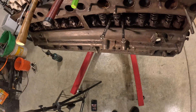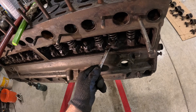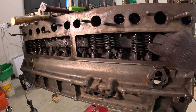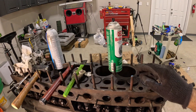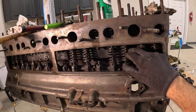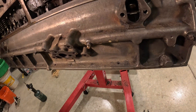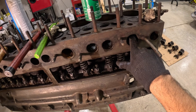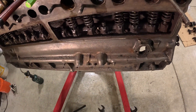This is what I found seems to work — I haven't found a better way to get these things out. This engine has solid lifters and they can be adjusted up and down. What I've been doing is applying freeze off and PB Blaster to the stems, trying to get them in as much as I can, letting them soak over the course of a week or so. I also had to use heat on the intake valves, shooting right in here through the intake ports and directly onto the valve stem and a little bit onto the guide.